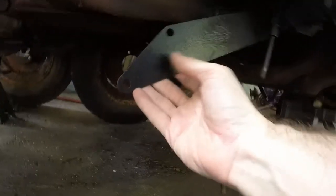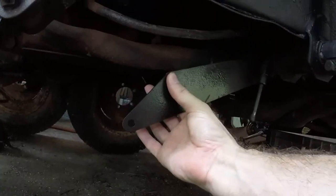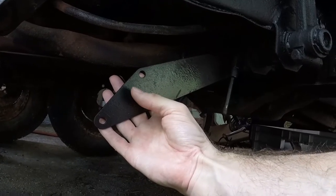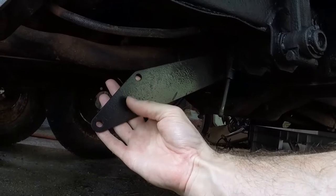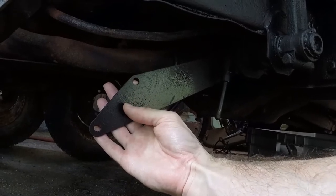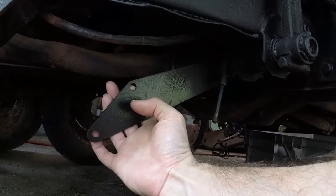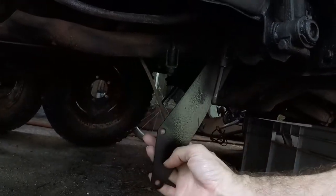You see this down here? There'll be a bolt that goes through this on the front half of the master cylinder. It goes through, and I'll show you in a little bit. It mounts with the bolt and nut and all that through the frame or through the bracket and on the inside of the frame. So I'll show that. And then this is mounted on a different threaded side of the master cylinder. So hopefully that kind of helps.